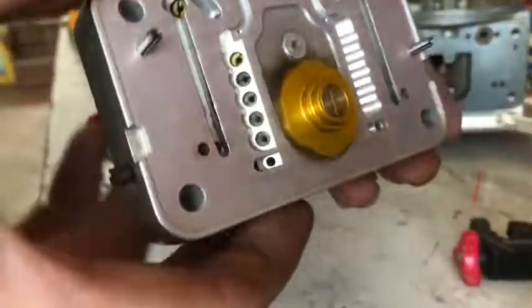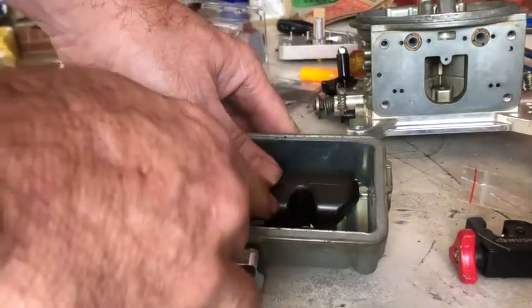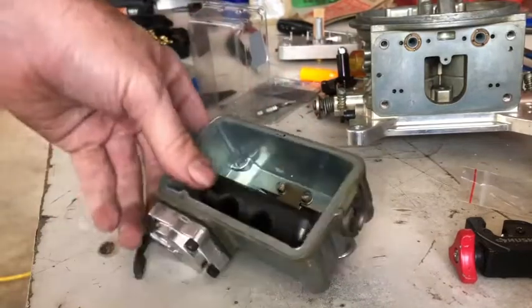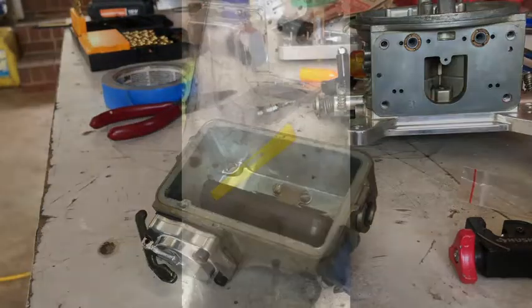There is our boost reference power valve installed. It's got an extension tube, which I kind of screwed up a little bit, but I'm actually going to put another tube on there with a bend in it. Because it has that extension tube, we are going to have to trim the center of those floats. So I'm going to pull that out real quick and trim that, just with a knife, and we will be all set.